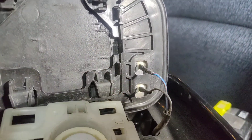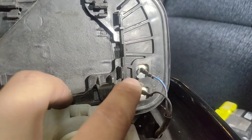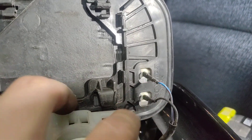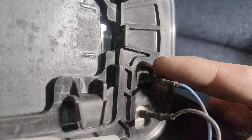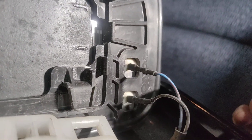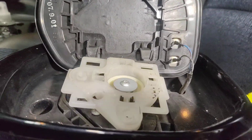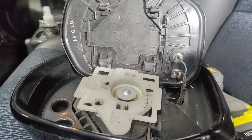These are the wires for your heating element for the heated mirror. If you want an aftermarket replacement mirror, it may not have them, so you can just snip them off or splice them on — they are spade connectors. If this part of your mirror is already cracked then you've got nothing to lose, but otherwise you can just cut those off and insulate them if your replacement piece does not have a heater element.